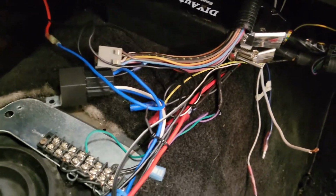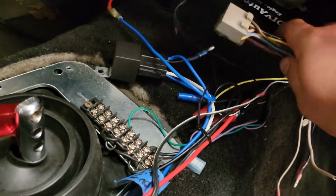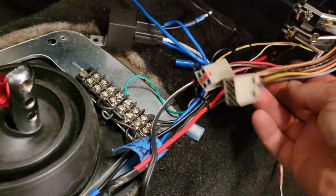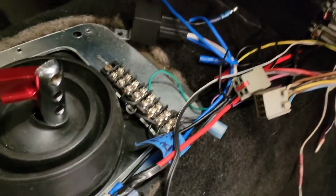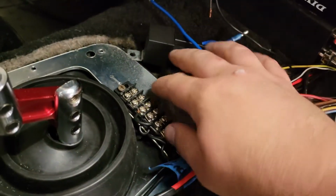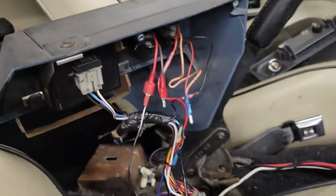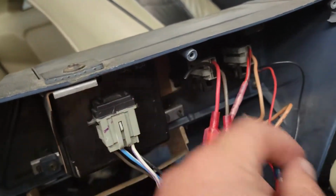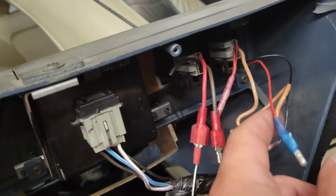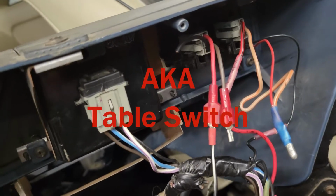And I have a relay here for, I think, the bottle heater. And I think one of these is being used for power for a light on one of the switches. Other than that, I took the relays out so I don't have to worry about all this space being taken up from the bottom of this thing. That's the back of the center console. And right here, I'm still going to have the factory clock, just like before. And this is to power on a nitrous to arm it. And this is our map switch, which is just an on-off ground switch.